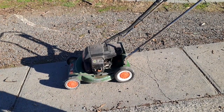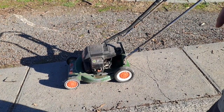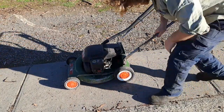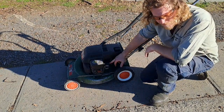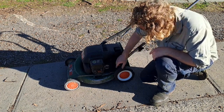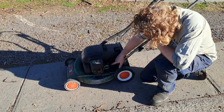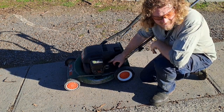There was also a Mustang version of this — a Mustang-branded model — I'll post a picture of what it looks like. The carburetors on these are called a G4 carburetor — one of the first diaphragm pressure carburetors. Fuel comes in through this jet, which is removable, and air comes in and goes straight off the flywheel, which tells you what idle speed it is. The governor spring and governor plate in there — the tension of the spring controls how much fuel gets in, which is how you set the RPM governance.